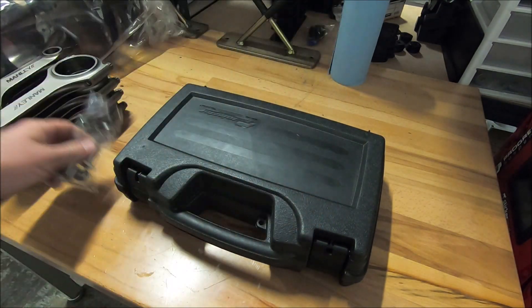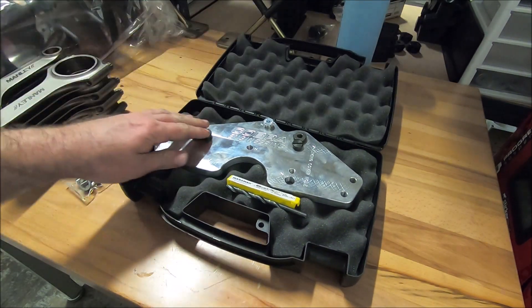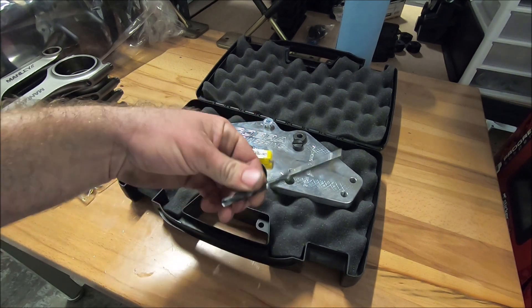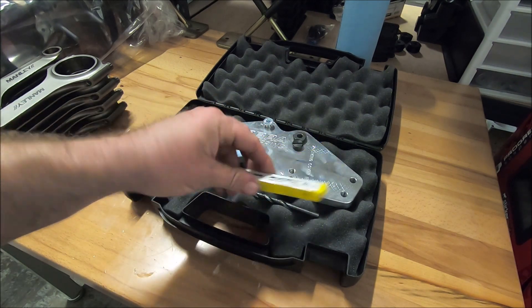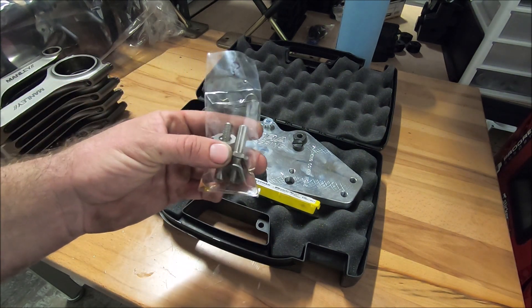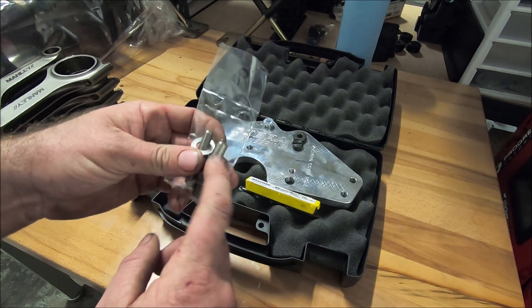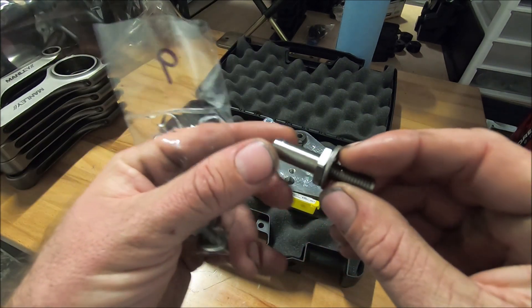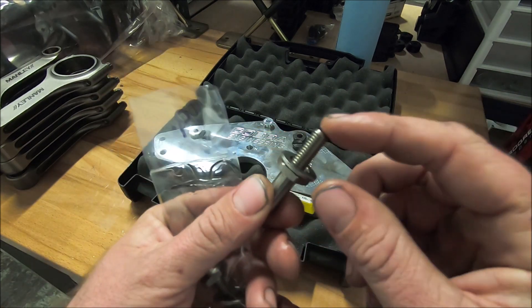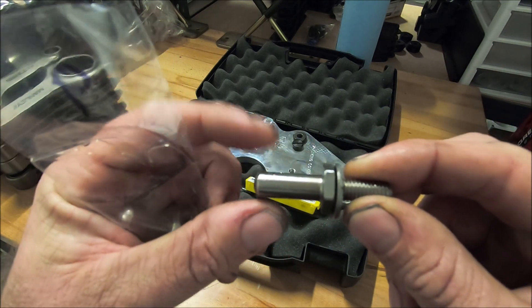Nicely machined. This is the kit — it comes with everything you need to drill and tap the new holes. These you have to buy separately. The pins come in 8 millimeter and 9 millimeter, referring to the actual part that it pivots on. What's good about these pivot pins is, one, the material is much stronger than the factory, and the threaded part is actually 8 millimeters.